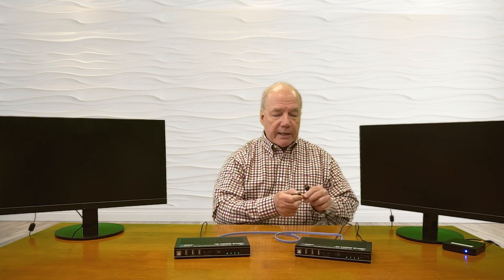That's a major benefit. To take advantage of that feature, you'll need one more HDMI cable — plug that into the HDMI output port on the back of the transmitter, then plug the other end back into the monitor at the primary side. What you'll see is the content being shared with that secondary location essentially mirrored right here, so you can enjoy it while sharing it with that secondary location. Stay tuned next and I'll show you the KVM functionality that this product provides as well.